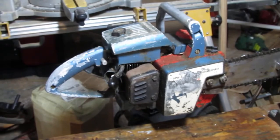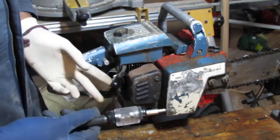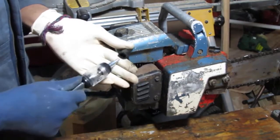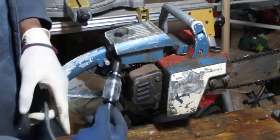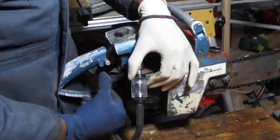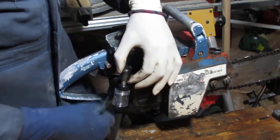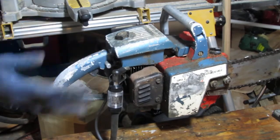Alright, let's have. So recently I got this inline spark plug tester. I just think it's a better way to go about testing for spark if you can use it. One of the problems with testing for spark by just pulling a spark plug out is that it's kind of inconclusive because spark changes inside of a compressed environment where the air pressure is higher. So it's also much easier than trying to fandangle it.